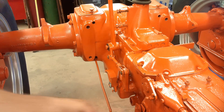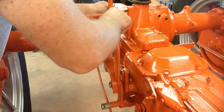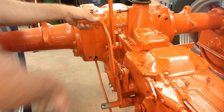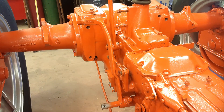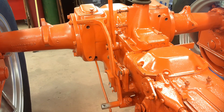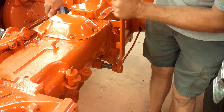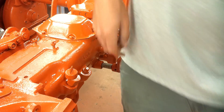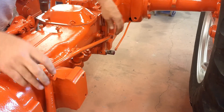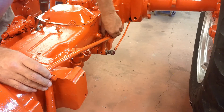Install the brake clutch pedal next — get a little grease in there for that. That's how the parking brake works. I can't do the right-hand brake yet because the frame rail has to go on first; that pedal actually goes on the outside of the frame rail. Now the clutch pedal can go on, and now the linkage for the clutch can go on — get a couple cotter pins for that.